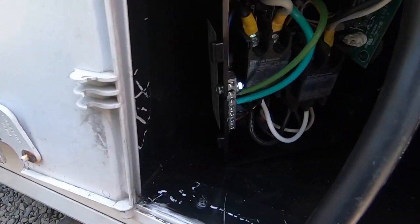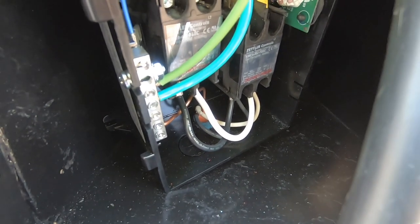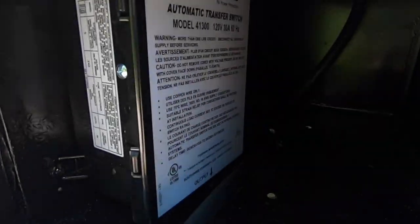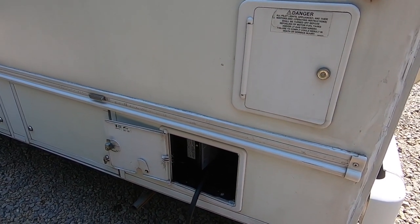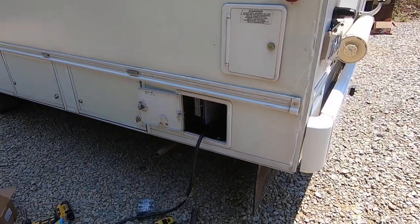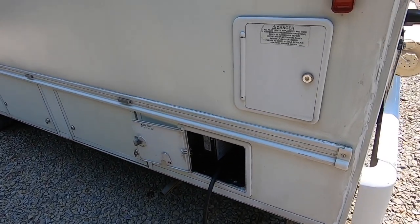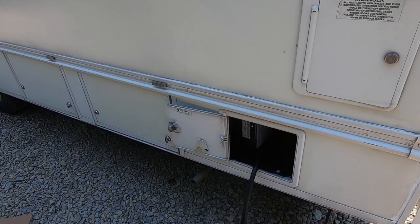Now I'm going to shut down the generator and we'll switch back — you'll hear the click back over to shore power. It instantly clicked over. Now I can go ahead and get the cover on and get it mounted. Everything's put back together, neatly contained in there. You may be installing this behind your electrical panel inside — that's a common place if your generator and everything comes together there. Maybe you're just replacing a faulty transfer switch; some motorhomes come with them when you buy them, this one did not. It's an easy upgrade that makes life a little bit easier for around $60. Be sure to like the video if it helped you out, subscribe for more, leave a comment if you have a question, and there are links in the description where you can buy this transfer switch. Until next time!